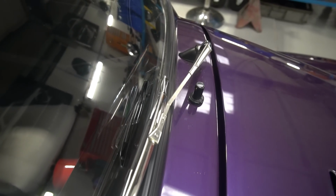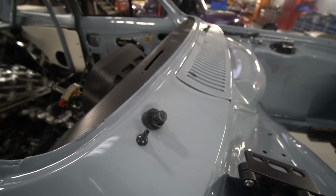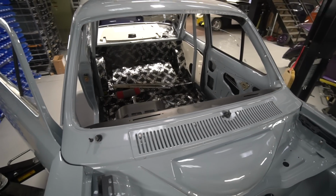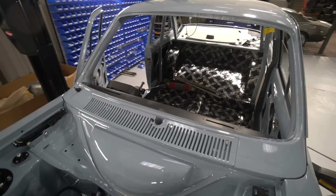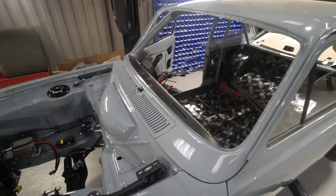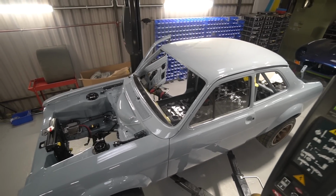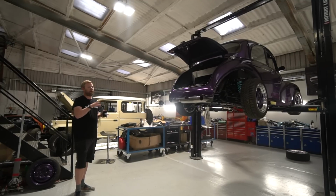However, on the subject of wipers, I don't know if any of the parts are laid out over here. We were thinking about the Mark 1 Escort setup, and the way that the wipers go onto the spindles on the Lucas type setups works, but on a performance car it's not that convincing. Now on the Morris we've actually drilled and grub screwed them to make sure they can't rotate on the spindles or come off. But we were thinking on the Escorts, it's a bigger screen, it would be nice to have some modern wiper arms and blades on there, and they're actually very similar to the Mark II setup. In fact, the spindles are the same separation distance. I think it's even possible to put a Mark II setup in there, but the bracketry on the shell needs to be different.